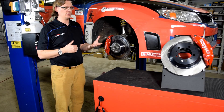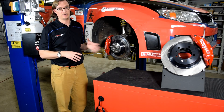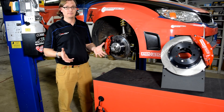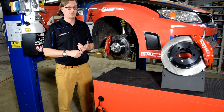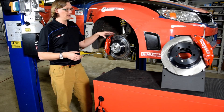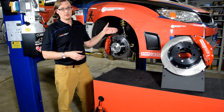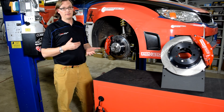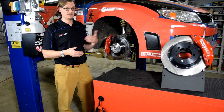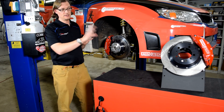Also keep in mind the cost of consumables. If you're putting a brake kit on your track car, don't just look at the cost of the kit itself. Look at pad selection and pad cost. Look at what rotors you'll need — with a two-piece rotor, the rings are almost twice as much as a one-piece rotor. So if you're tracking the car a lot and using an aggressive brake pad, factor that in to make sure it's the right fit. That's partly how we landed on the four-piston over the six-piston for now.